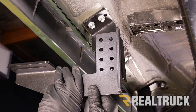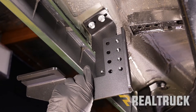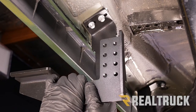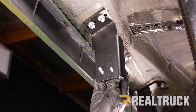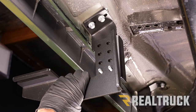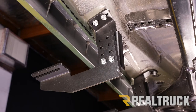Here is the bottom bracket half for the three rear brackets. This portion faces towards the rear of the vehicle, and the foot of the bracket also faces towards the rear. Again, it has four hole locations. We want to make sure all brackets are set to the same height, so we're going to the standard drop. We'll put two serrated flange bolts into the bracket, line it up to the holes, and install the hardware onto the bolts finger tight. Repeat the same process on the next two brackets back.